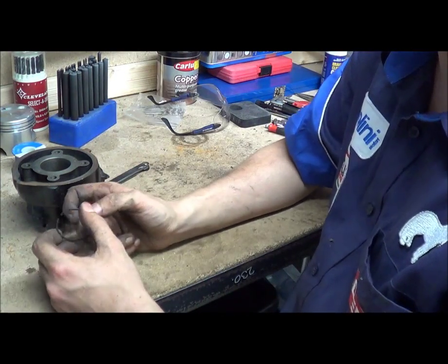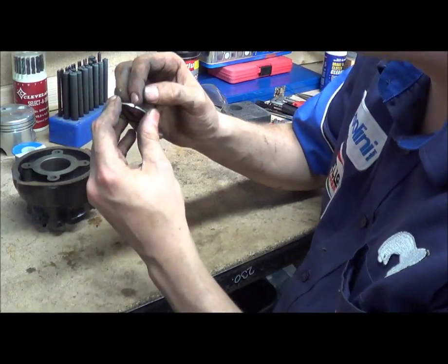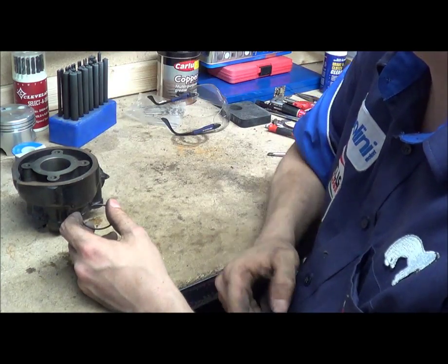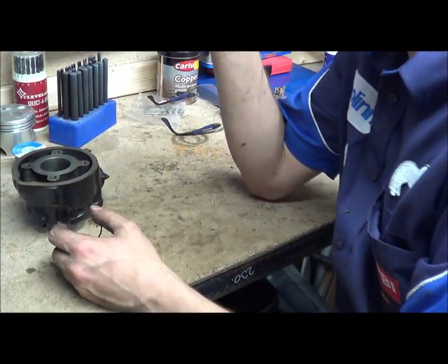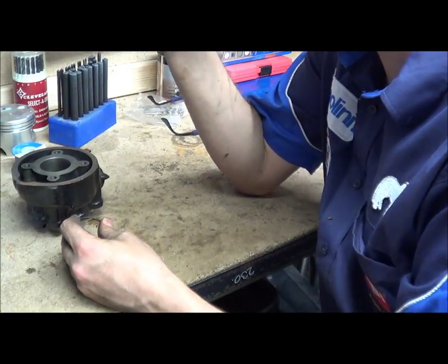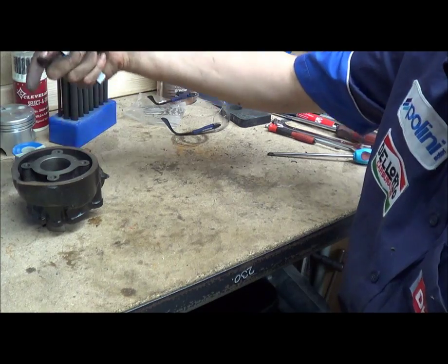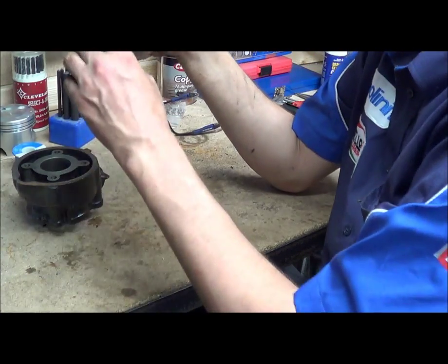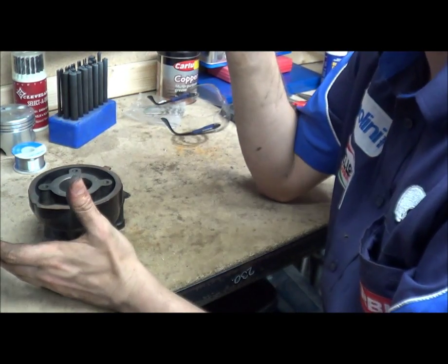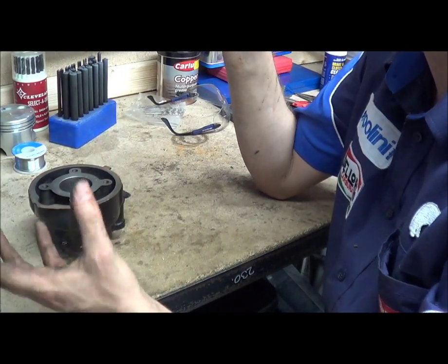So what has this got to do with ring end gaps? The fact of the matter is there's a gap between each end of the ring, and this gap has to be accurately designed and accurately maintained. If the gap is far too wide, you just get gas blow-by, which is when the combustion process goes round the piston and enters your crankcase — not a good thing because you're losing power. You also start heating literally like a blanket around the piston, and the piston starts to expand and might seize.